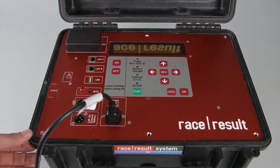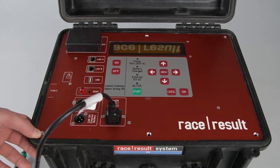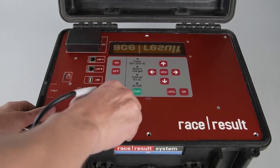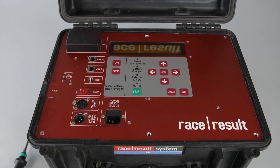You need to make sure that the decoder is updated to the correct firmware and to the newest one. After that, turn the decoder off and make sure to unplug the power cable, as we're going to expose the inner leads which are powered if you have it plugged in.